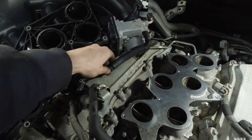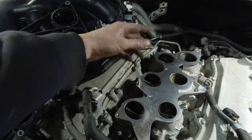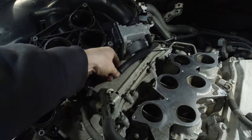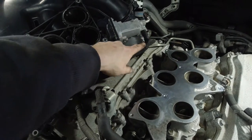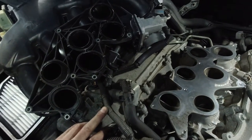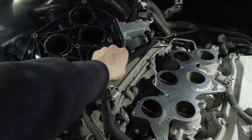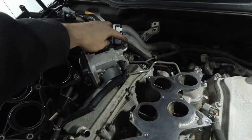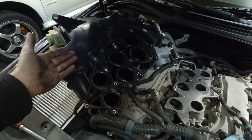The reason it's like that is because the throttle body has coolant going through it. You don't need to take this hose off. You will have to drain the coolant a little bit, or if you're replacing the intake, you can just pinch this rubber hose and take one line off - you're still going to have some coolant spill but it won't be a lot. I did not disconnect these two hoses; there's plenty of room to just put it aside.